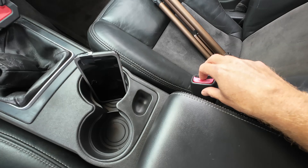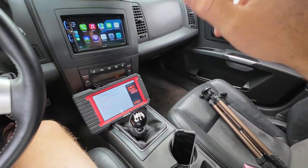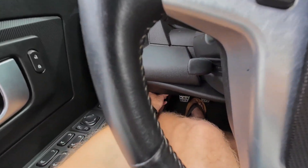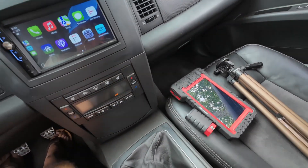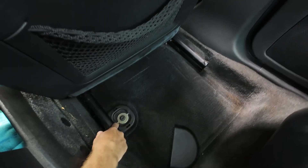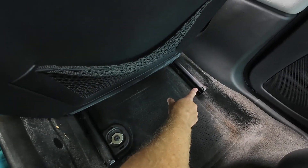So we need to first test it. Let's move the seat back — I'm going to unbolt it and disconnect the car battery and let it sit for at least 10 minutes. Really nice scan tool, it also does bi-directional commands — one of my favorites. On this '05 CTS-V, just the rear of the seat has fasteners: one here, another there.